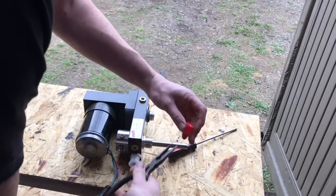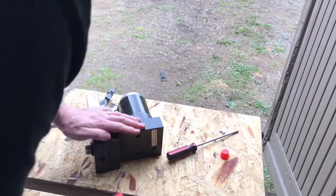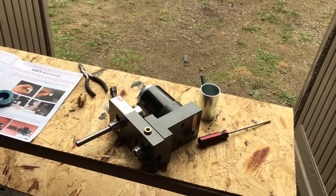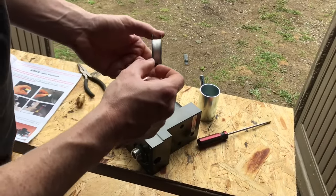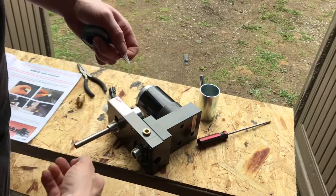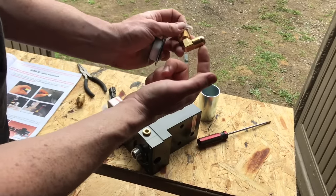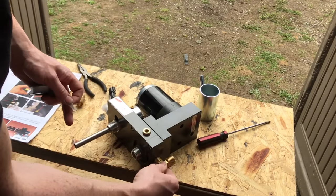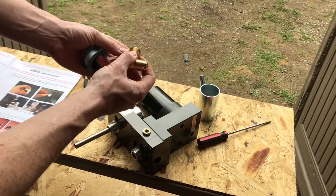Go ahead and pull off these little covers or caps inside your pump. Next, take this fitting and use some threading tape or Teflon tape. Note: this is not going to screw into the pump on this side with the flat piece — as you can tell, that's going to go upward, like that, not in like that. That's the correct orientation, so make sure you guys don't miss that step.